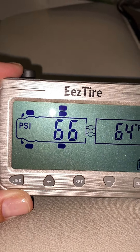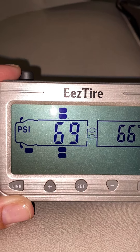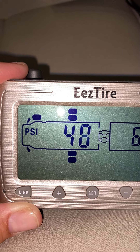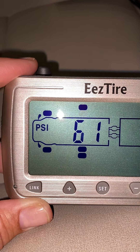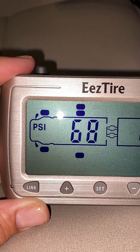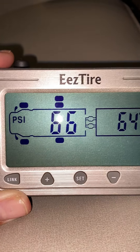You can see it's flashing. I have six tires on my RV. My back right tire is at 66 PSI, my front right is at 69 PSI, but the left one is at 48 PSI — so obviously that's low tire pressure. All my tires actually need air; they should be between 70 and 80 PSI, which I found on a sticker inside my driver's door. It also shows the temperature of each tire.